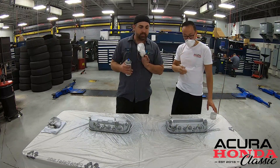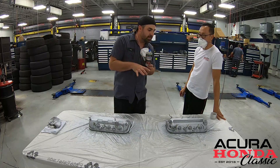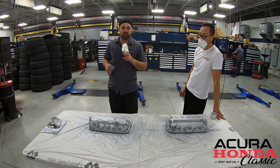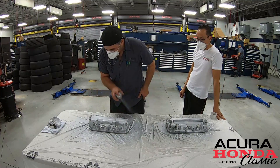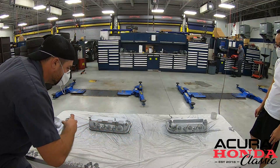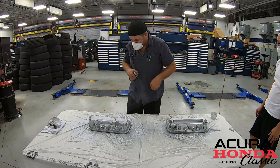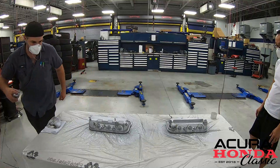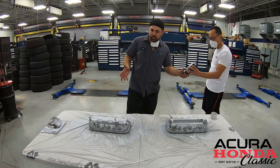This is the last coat. What I'm going to do is put it on wet, then back up and kind of dust the final coat to make sure all the little metallics are oriented and it's nice and even. Instead of small strokes, keep it about 12 inches and just dust it over the whole thing. And that's it — leave it alone. It looks a million times better.